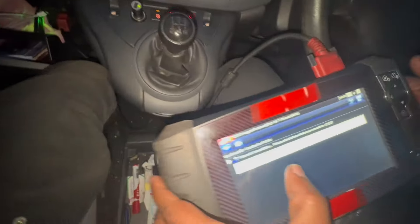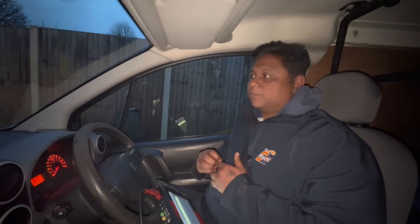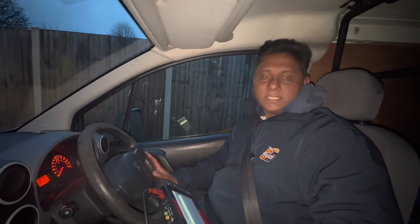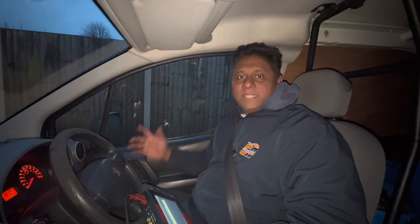You can see only the fuel temperature code remains. So I'm going to advise the customer to address the temperature sensor - if not, I'll ask them to bring it back. However at the moment this fault code is a concern, because if they leave with this fault code longer then again the DPF could become blocked. I'll ask them to do it sooner. If you have a problem like this, you know what to do now - get a good idea of what's going on first, then take action for the cleaning process. If you need to replace a part, do it, then after that the car will do the cleaning itself. That's it, thank you, nice one - see you in the next video.